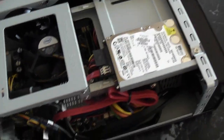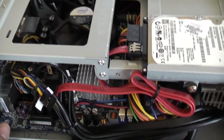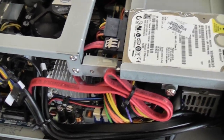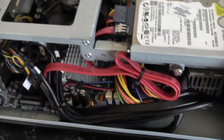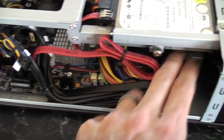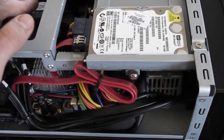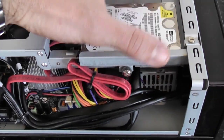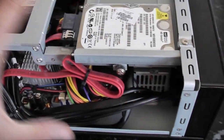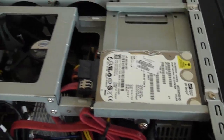The power supply lives underneath inside there, and you've got to do your maths a bit. I spent time on Intel's website figuring out how much power the processor would draw and how much power a hard drive would draw, making sure everything wouldn't stress the power supply. I managed to keep some headroom — just one hard disk, the CPU, RAM, and motherboard. Because the case is quite cramped, even though there's air grilling for ventilation, you've got to be a little careful of heat.